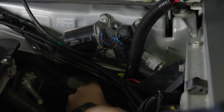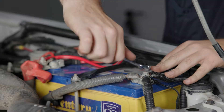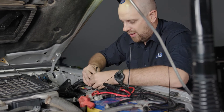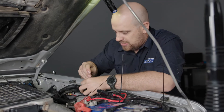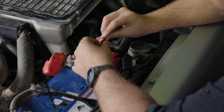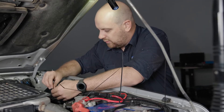The important thing to know is you should be avoiding anything that is excessively hot — exhaust manifolds, turbos, anything that can melt wiring. And the other important thing is to avoid any moving parts. Cable ties do two things: firstly, they neaten your installation, but the second and probably more important thing is that strategic placement of cable ties prevents cabling from moving. Cabling that moves or has excess tension on joints, connectors, or curves is going to be much more prone to failure and will fail a lot quicker.